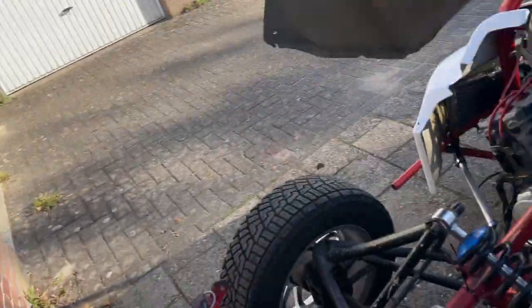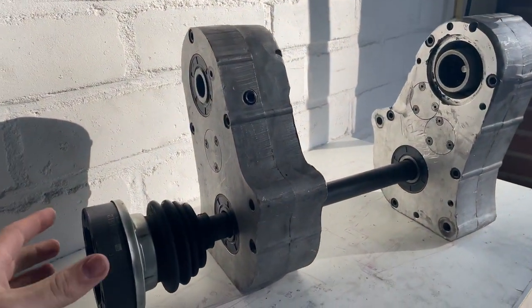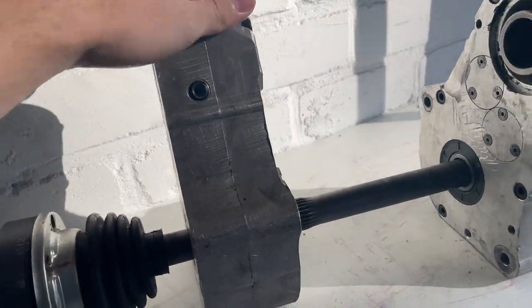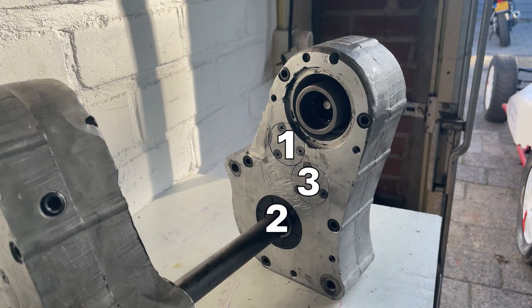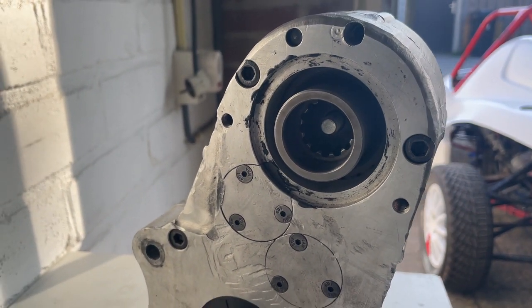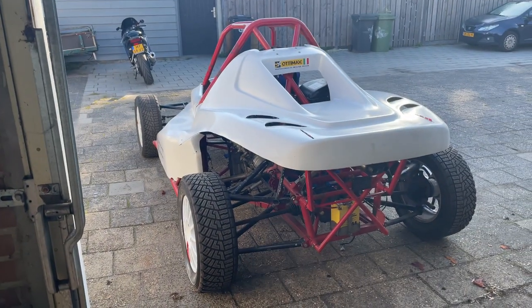I had to reverse the direction of that engine to match the right direction that the other engine already has. The guy I bought the gearbox from also told me there was just one axle going from one differential to the one in the front, which is exactly why I needed this gearbox. It belongs to that car and completely solves everything: the differential will be placed right here directly onto the CV joint, then we have this gearbox connected to the left engine, and a second gearbox connected to the other engine. Because this gearbox has four gears, if I spin this axle clockwise the upper gear spins counterclockwise — exactly what we need.